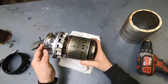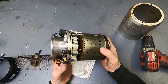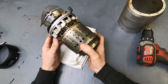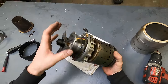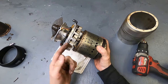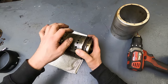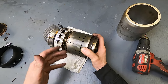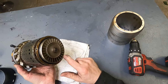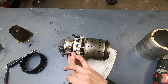So that's what's inside these engines. Basically a bunch of injectors, a combustor right here — that's what this is, a combustor can. Then this is technically the stator, so this would be the compressor in the front — kind of looks like the front of a turbo. The air comes through that compressor into this stator, back into the combustion chamber, which consists of this combustor plus the cooling air and mixing air. Whatever fires up inside that combustor comes through the turbine, which propels the entire cycle again and again.